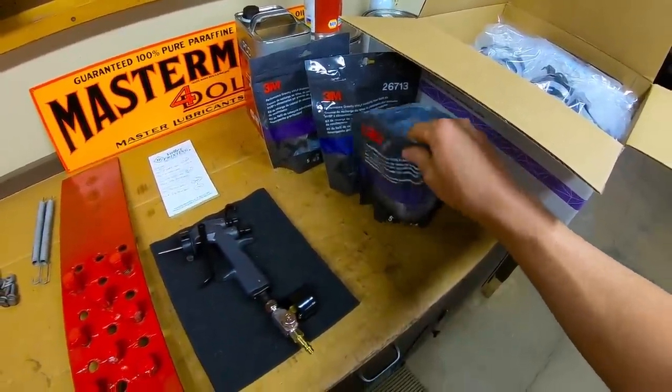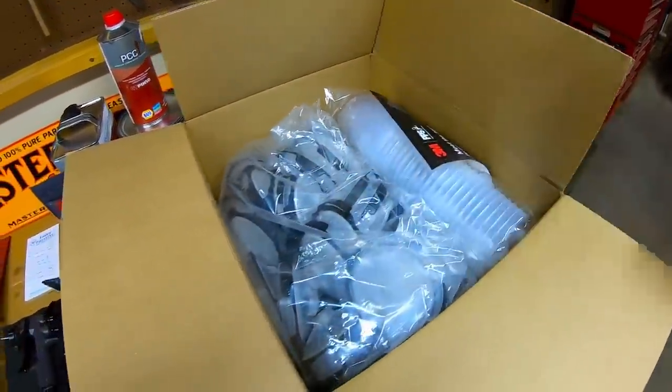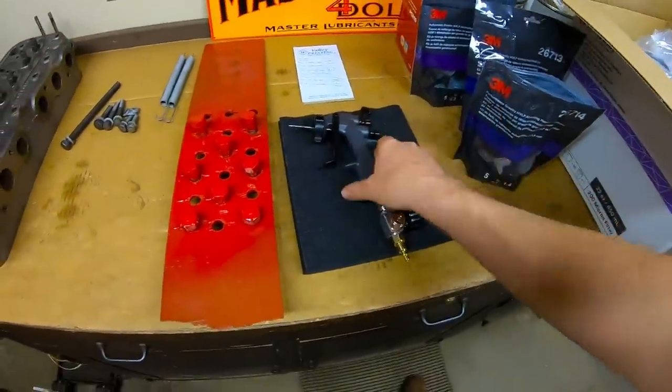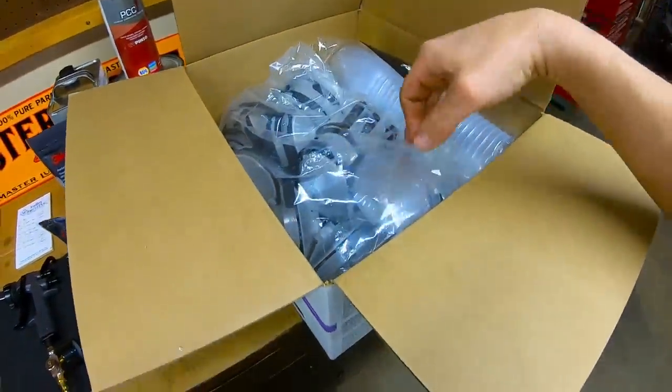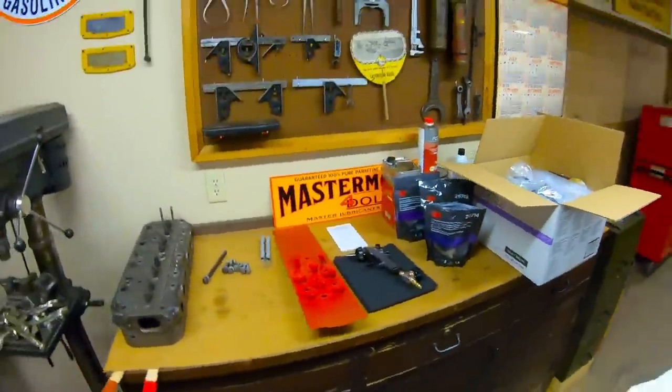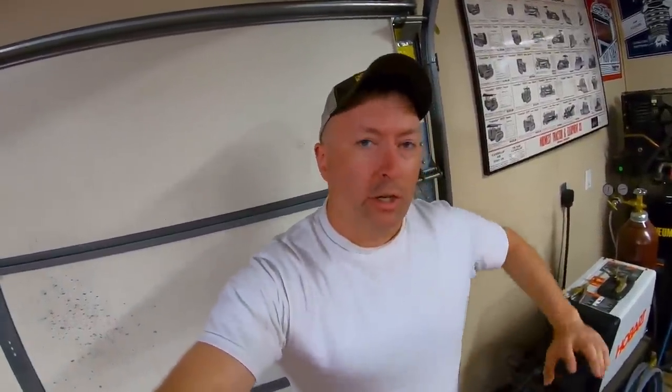If you don't feel like cleaning it, throw it away when you're done. And they sell boxes and boxes of liners and lids. We did get 3 uses out of the last nozzle and the last liner and lid today. If you don't let any of that stuff really set up and you keep the paint rather fluid on it, and just take it apart, clean the lip, dump the next batch in, and put it together before any of that stuff starts to tack up, we got multiple uses out of them easy.